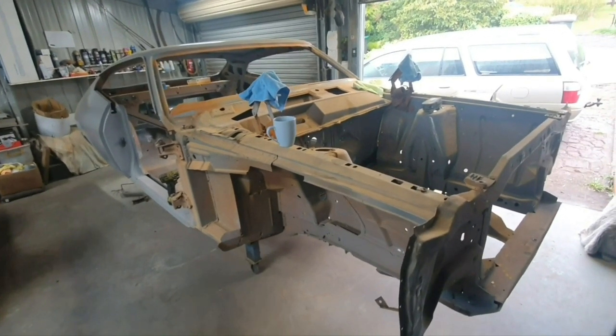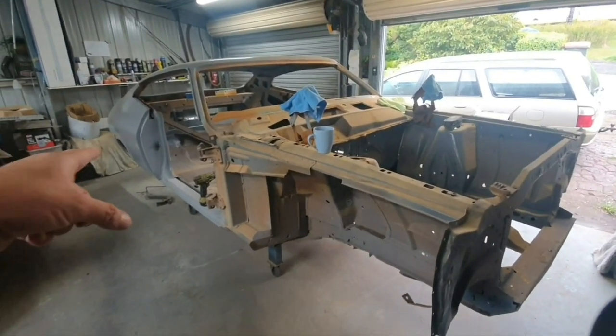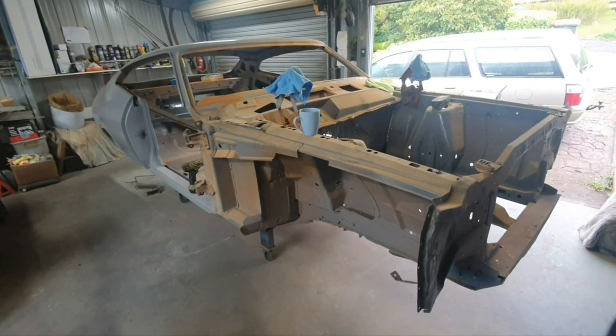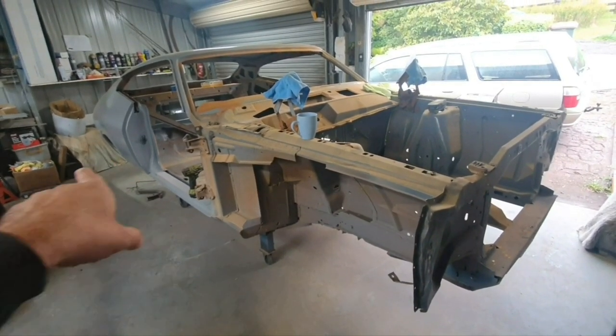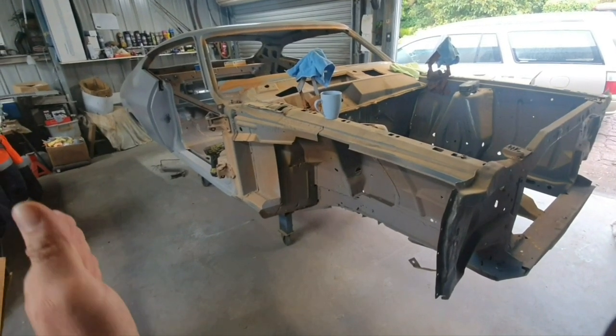I came across this post and this bloke — Adam Van Der Linden, I think that's how you pronounce his name — he's a really good fabricator. He makes re-quarters, door skins, boot skins. He's like an absolute genius when it comes to these cars, making stuff for them. I started talking to him about the body line of the door on my car. The bottom body line — I'm a bit funny about how it is — and he said it slightly goes out where mine slightly goes in. So what I'll do before I put the doors back on, I'm going to put them on stands, get in the reflection and really look at it, see if I can put a little more filler on that line and build it up a bit.